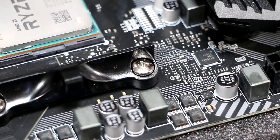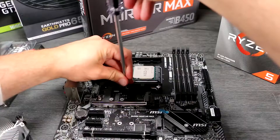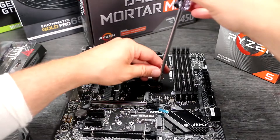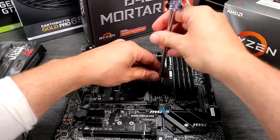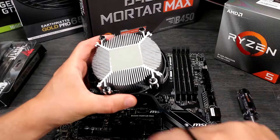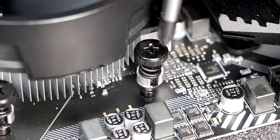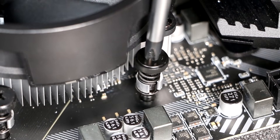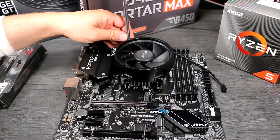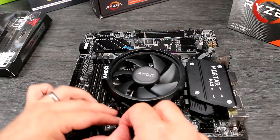Here's how you install the AMD stock cooler. AMD motherboards ship with two hook-style retainers on the socket, which are used with the Wraith Prism cooler that comes with the Ryzen 3700X or higher. If you're fitting that cooler, you don't need to modify anything here. However, the coolers that come with the Ryzen 3600X both require you to remove the clips. This allows the cooler to screw into the back plate behind, so use your screwdriver to remove them. The cooler has thermal paste pre-applied, so you just need to fit it over the CPU socket. The retainers on the cooler are sprung screws to ensure the correct mounting pressure on the CPU. Hold the cooler in place and screw it down corner by corner. It can take a bit of force to overcome the screw spring pressure, so go carefully. Doing opposite corners in turn in a star pattern can help, and don't over-tighten the screws — just bottom them out. Finally, route the fan cable neatly and plug it into the CPU fan header. It's normally close to the socket and marked CPU fan or similar, but consult your motherboard manual.